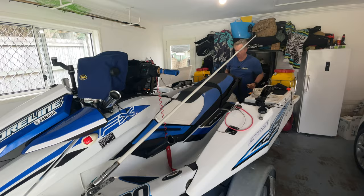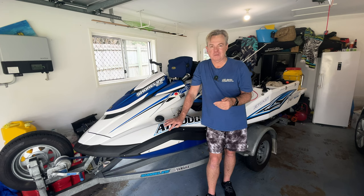Make sure all straps are firmly on, including the rear seat. One thing to be very careful about is tire pressure on your trailer. If you neglect that you can have a blowout and that's going to ruin your morning. I've had a blowout once and learned the lesson about tire pressure, so I always check the tires.